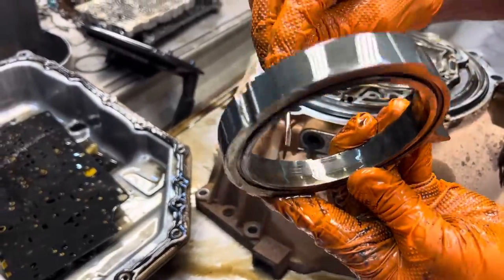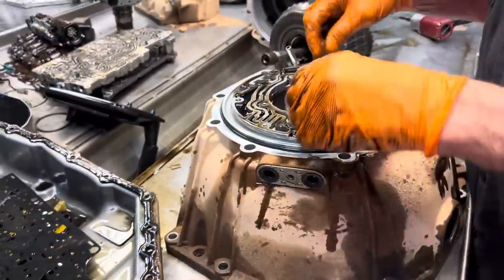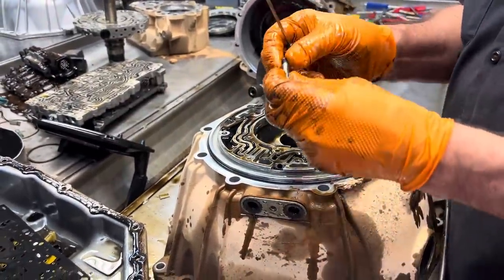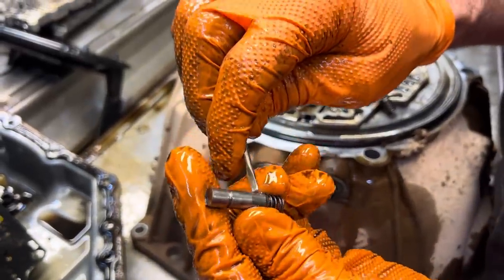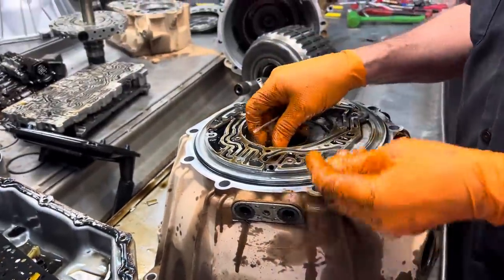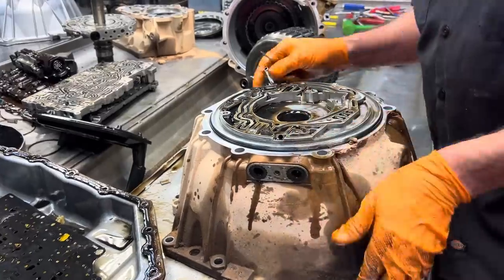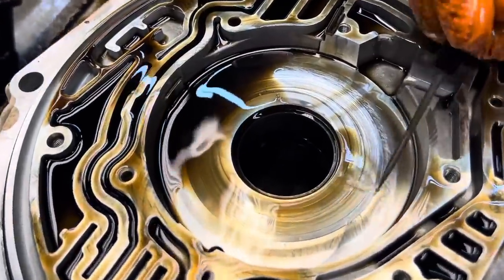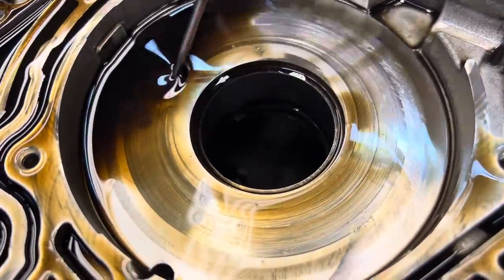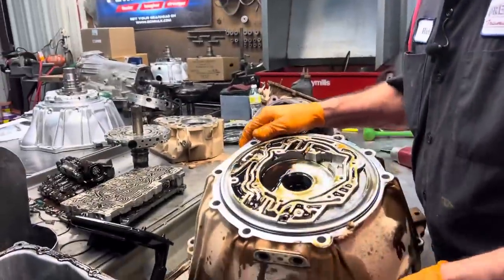Now the pump slides are really wore out towards the bottom through here. Looks pretty good on this side. Pivot pin here, starting to get some wear. So replace all of those too. Of course, you can see here how wore out that is. I mean, it just rutted all the way through. So we already knew that this part was going to be wore out too, pretty much.